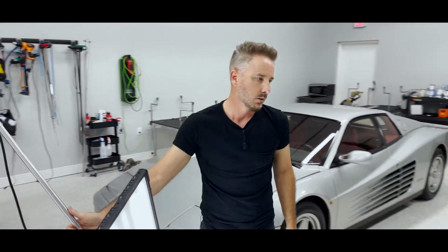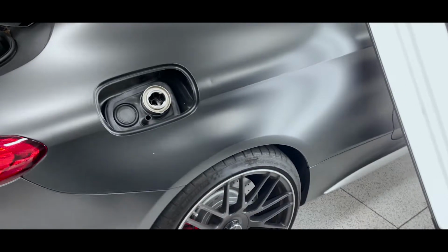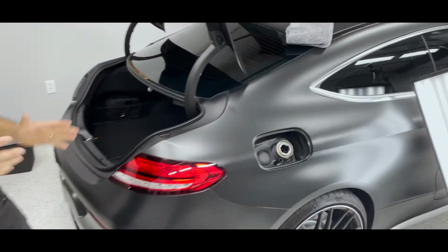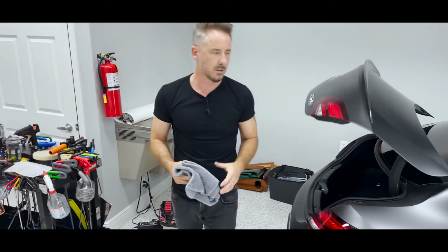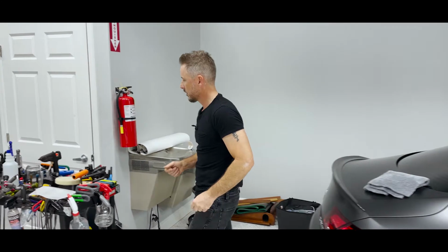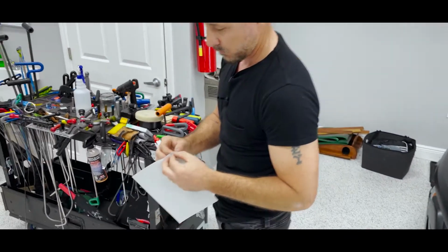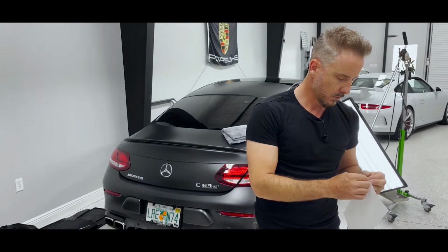Now we're going to talk about the dent, see what it looks like. Illuminated, it's about a 1.5 inch crease, maybe a 2 inch total, which is important. Dealing with that guy right there. And at this point I could go in here and I could go ahead and fix this dent, really no issue at all. But because really great, amazing paintless dent repair is based on reflection, I'm going to show you guys how I go about it. I've got a little piece of paint protection film here. Eventually I'll get it.